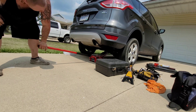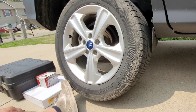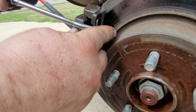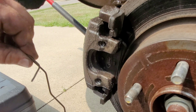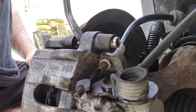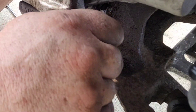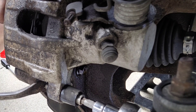Now we're moving to the back. Go ahead and jack it up because we're doing brakes and rotors on the back. We've got the tire off. It's almost the same as the front but it's a smaller clip. Once again, we're using our flathead screwdriver and prying it out — this one didn't fly off like that other one. Caliper bolts are the same, it's a 7mm Allen head — exactly like the front. Go ahead and take them out. You can use the screwdriver to pry the caliper pins out. Now let's go ahead and take the dust cap off and pop them off.